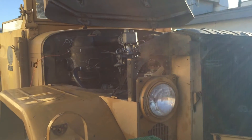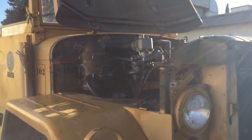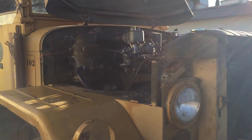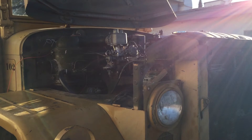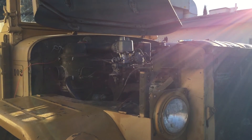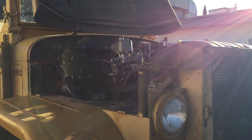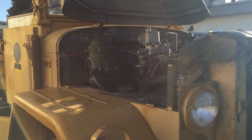A little bit of adjusting to do still on that carburetor. There is a return spring on there, but moving it just a little bit puts it in fast idle. So I probably got to take all those linkages apart, clean them, grease them. May need a little stronger return spring. There is a little slop in that linkage on the carburetor or governor itself. Well, a million things to do, but making progress.